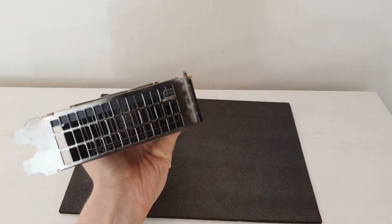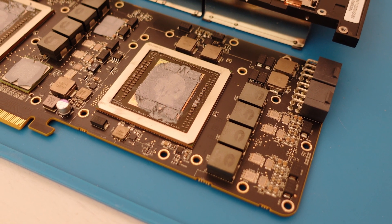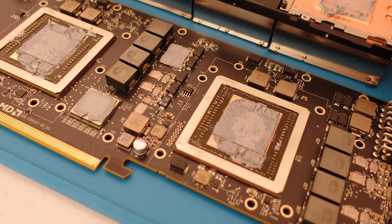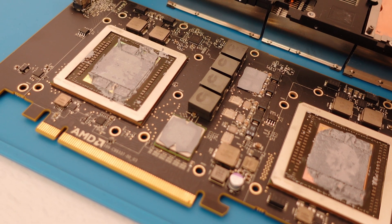The next comparison is between S9300 X2 and R9 Nano or Radeon Instinct Mi 8. As we can see from the PCB comparison, S9300 X2 is basically two R9 Nanos slammed together on a single PCB with a PCI Express switch. This PCI Express switch provides a PCI Express X16 connection to both GPUs, so both can use all 16 PCI Express lanes. However, if both GPUs try to use all 16 lanes simultaneously, the bandwidth will be halved for each.